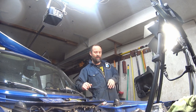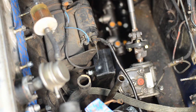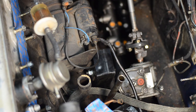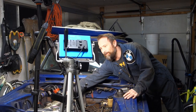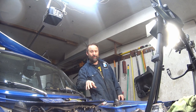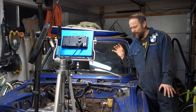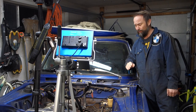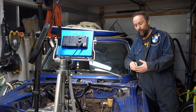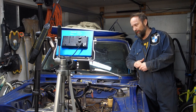I've also done the steering Guibo — that's all brand new. And I also got a new set of engine mounts in there, which are great: they are super stiff and fairly easy to install. Between all the loose hardware that was on the engine mounts and the terrible state they were in with the dissolving rubber, the engine is super stiff now — it's basically just shaking on the springs. I'm really happy with that. I didn't box in the engine mount yet; I will probably do that in phase three if I ever get there, just because that whole subframe has got to come out to do that properly.